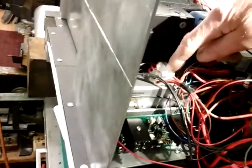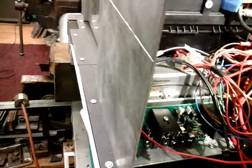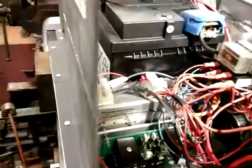And then on top of the control panel I've just put some connecting blocks to connect all my positives and my negatives to. And then right underneath on there is where my two main wires go out that feed my motor, and I've insulated round them so they don't rub on the framework, with some of that concertina sleeving you can get that's got a split up it - so that's what I've insulated that with.